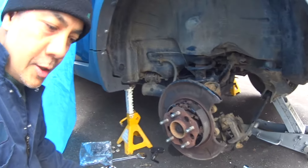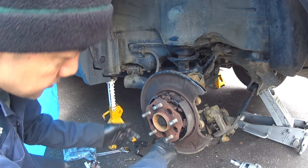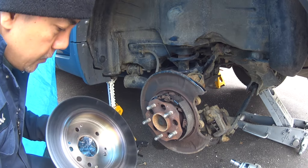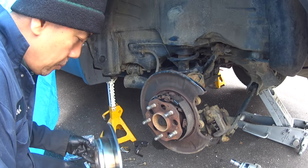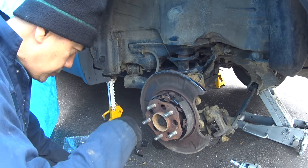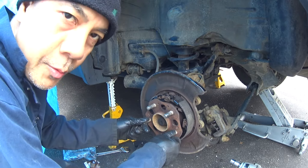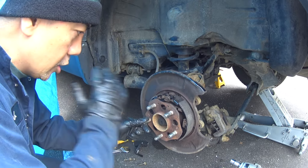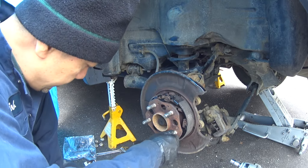So here's what I'm talking about — shoes. And yes, they go on the inside of the rotor. It's for the e-brake. These are the new ones already; I've already put them in place. I just want to show you guys the old ones. They're not supposed to wear down because you only use them when you need the e-brake. But it was all gone — the original ones. I wish I could show you but I threw them out. Yeah, they were down to the metal.